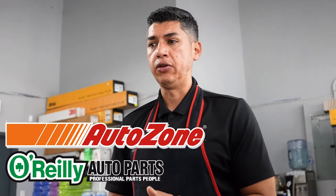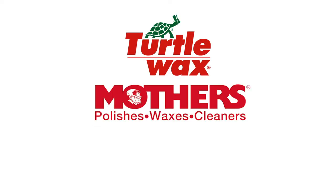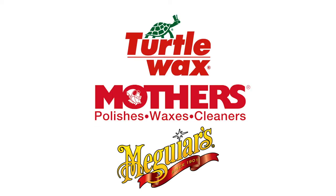You can find this in AutoZone, O'Reilly's, or any discount auto parts store, which will have a different polish. There's many brands, Turtle, Mothers, Meguiar's. Meguiar's is very, very well known. So if you're not really too concerned about the swirl marks and you have a light color car like this, just go with a light polish, a medium cut polish, medium cut pad, and you'll be fine.